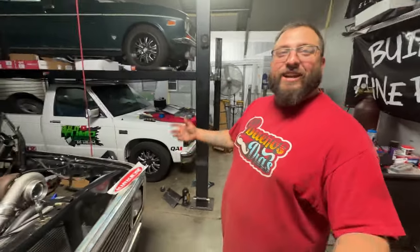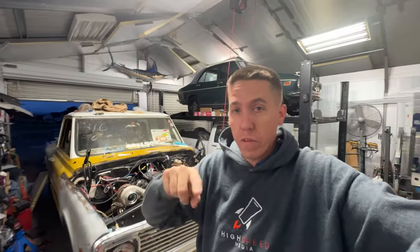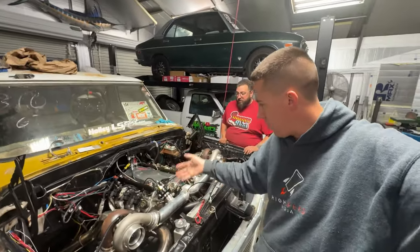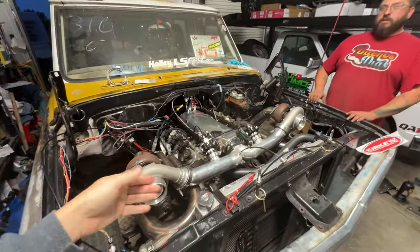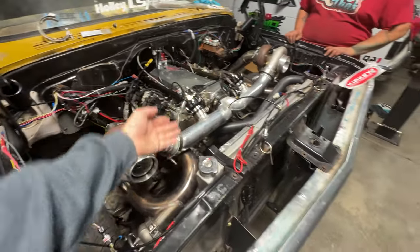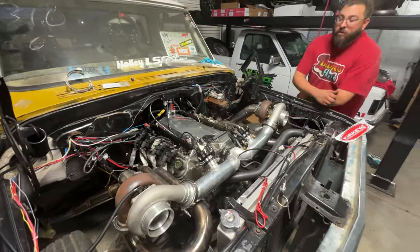If you want to see more or follow this build as he's racing, go over to 5150 Adventures — AJ has a YouTube channel making videos about this truck. More or less it's a pretty cheap turbo kit: used turbos, reusing piping, no intercooler, super budget build. What did you get into the turbos? About $600 for both turbos and wastegates. He bought new blow-off valves, we reused piping, got new injectors because we're going to run it on E and play with fuels. Thanks for watching — we'll see you next time.